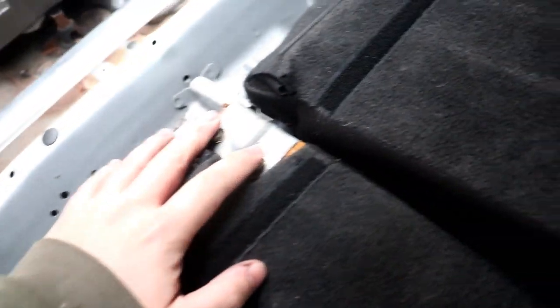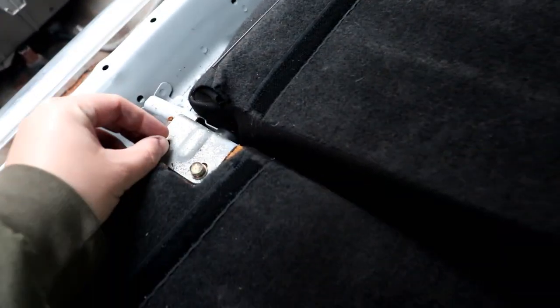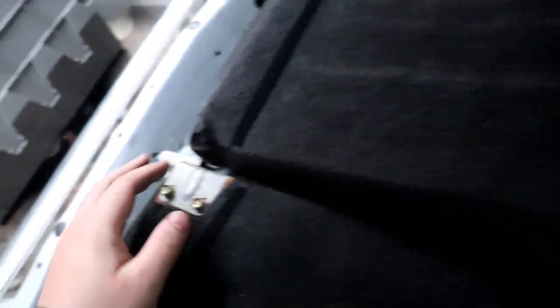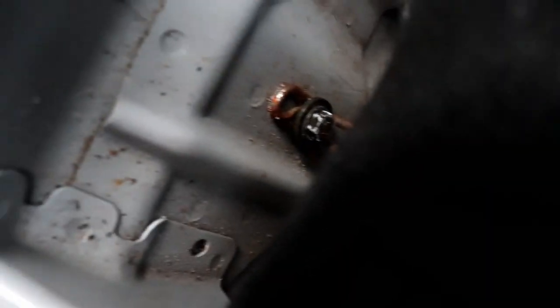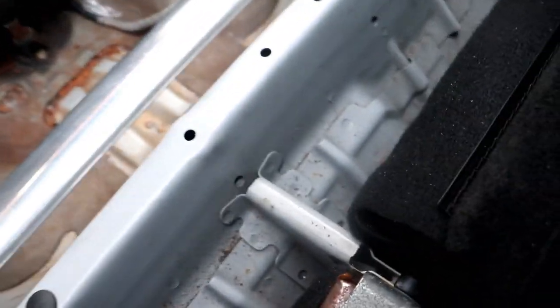Quick rundown: there's this bolt, and another one on that side — these six bolts are 10mm, take those out. These seat backs come out, and then over here there's a bracket with another bolt, I think it's a 12mm — that's what holds them in place. And then this bolt right here which I think is a 10mm also — take that out and then you can simply lift up on the seat bottom. It's fairly simple, so let's get to it.